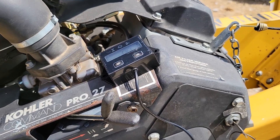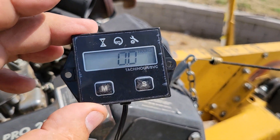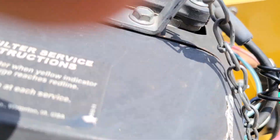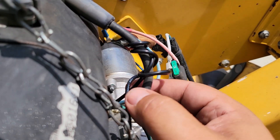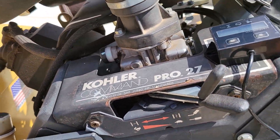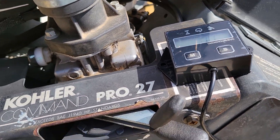We're going to go outside and use this tachometer. Some people say it's 3600 RPM. Here it is — there's a little plastic light box with a battery built in. It's a tachometer and also an hour meter. It comes with a long cord. The spark plug wire is wrapped — one, two, three, four — and then four coming across. With the other one tucking in, that's five wraps.